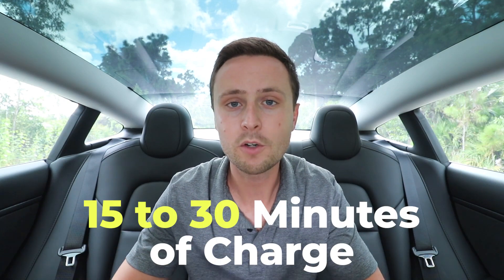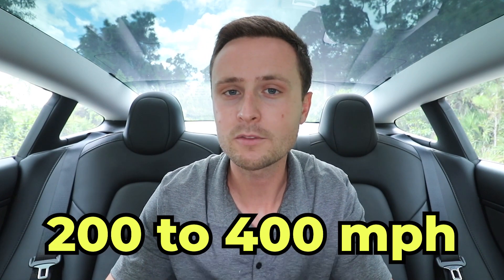The third main way to charge a Tesla is with a Tesla supercharger — essentially like gas stations along the road and by far the fastest way to charge. You can expect over 1,000 miles per hour of charging, meaning it takes about 15 to 30 minutes to essentially fill the battery. One important catch: Teslas charge fastest on a supercharger when the battery is very empty. As the battery fills up, notably from about 80% to 100%, charging slows significantly — dropping from over 1,000 miles per hour down to around 200 to 400 miles per hour.